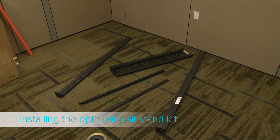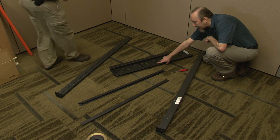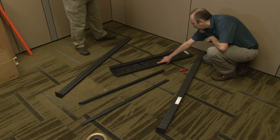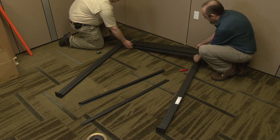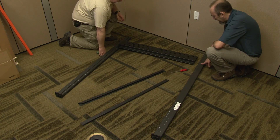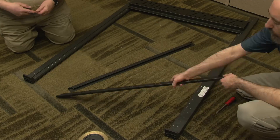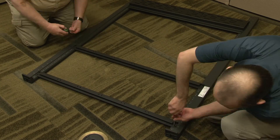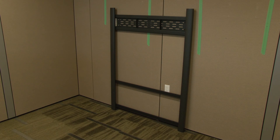The Smart wall stand kit is added to the wall mount. Pay attention to the up indicator when assembling. Be sure to assemble it with the top of the wall mount positioned at the wall stand height marking indicated in the installation guide for your specific system model. The position of the lower bars on the wall mount is not specific — place them where you desire, making sure to avoid interference with any electrical outlets or other obstructions on the wall.